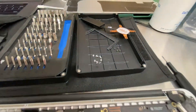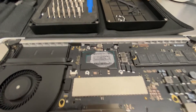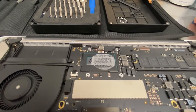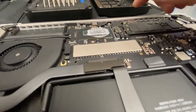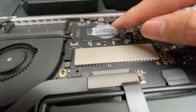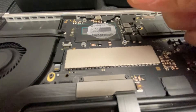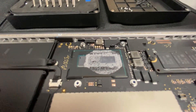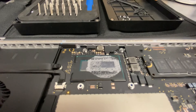So I'll tell you what happened to my laptop. This is a 2015 model MacBook Pro 13 inches, and there's been an issue where the laptop started acting very slow. One of my friends told me it's because of the thermal compound on top of the processor to the heatsink. Over time of use this thing dries out — as you can see right now it is very dry — that's why it's not reducing enough heat away from the processor and your CPU is overheating.